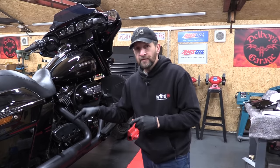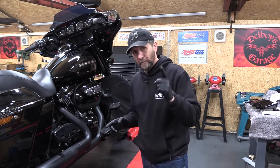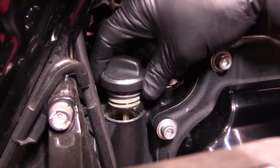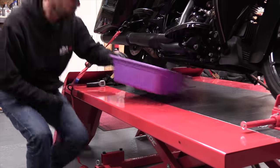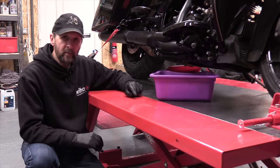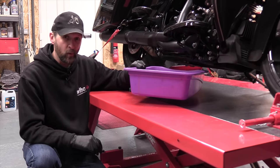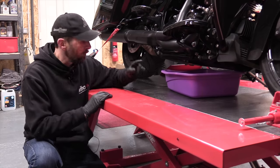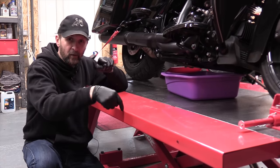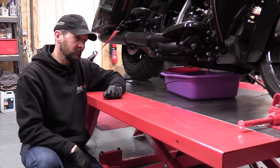All oil changes start with draining out the oil, so let's do that first. Loosen the filler plug before you start — that allows air into the engine so the oil can drain out and prevents a vapor lock. There are four quarts of oil to drain, and it's hot because we always drain it out hot. The drain plug faces forward, so make sure your drain pan is big enough to contain four quarts and positioned where it can catch the oil, because the forward-facing drain plug will initially shoot the oil forwards and then down.